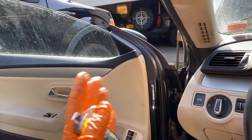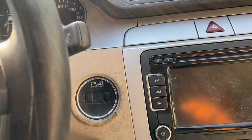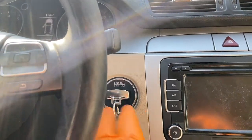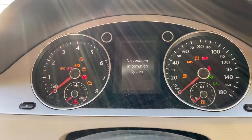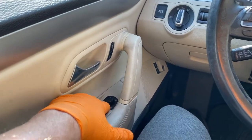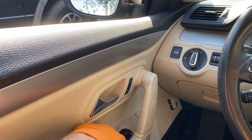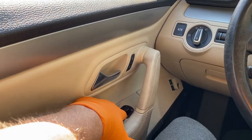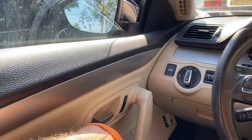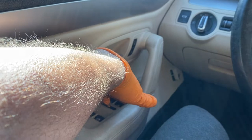Make sure all the doors are closed. Put the key in the ignition and push it until all the lights come on. Now take the two front window buttons and push them both down. Make both windows go all the way down, and once they're all the way down, count five seconds while keeping the buttons pressed. Then lift them up, make them go all the way up, and once they're all the way up, still holding the buttons, count five seconds.